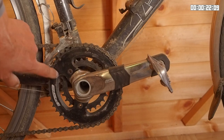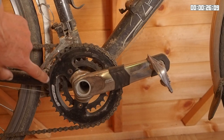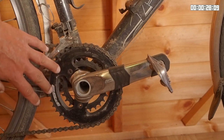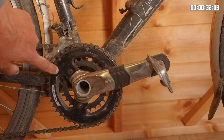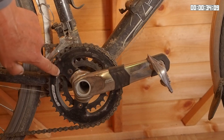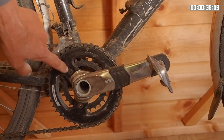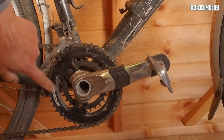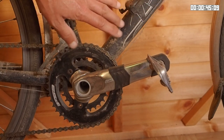The main issue is that the large chainring is worn out and needs replacing. I would like to have kept this chainset, but unfortunately I can't find a chainring that will act as a replacement, mainly because this is a fairly non-standard fitting with three-point locations. So I'm going to have to replace the whole crankset.